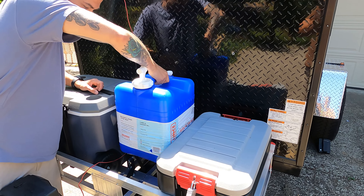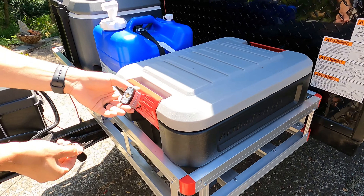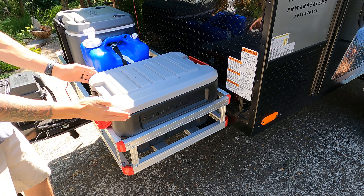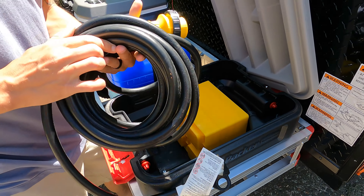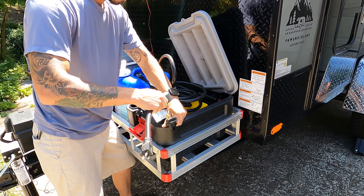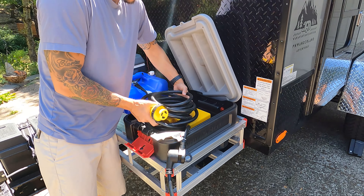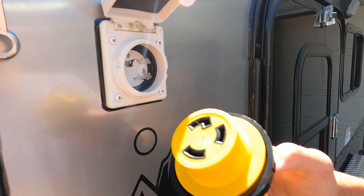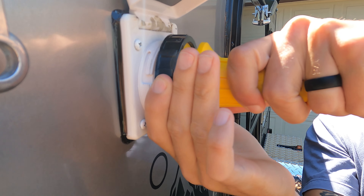Be sure to re-secure the container before you travel again. This silver key is used to unlock the front storage bin. Inside are all kinds of things, including the 30 amp shoreline cord for plugging in the trailer at a campground with full hookups. There's also an adapter from the 30 amp plug to a regular 15 amp plug. The bright yellow end is the trailer side — a 30 amp twist lock connector. Align the pins and twist the connector into place; the black collar tightens to keep everything secure.